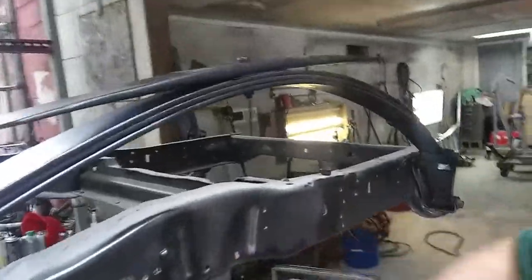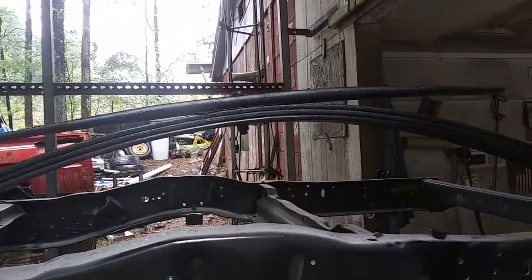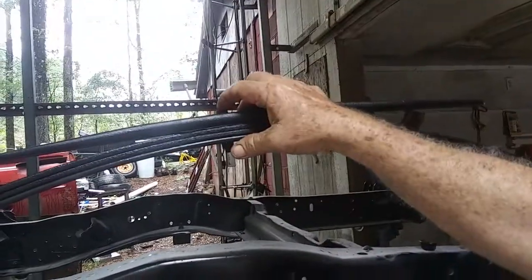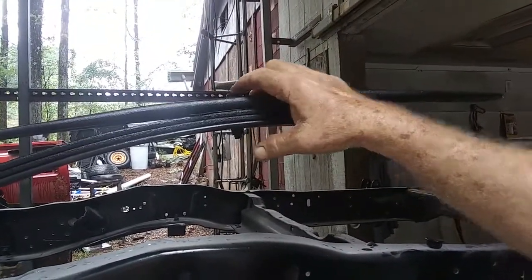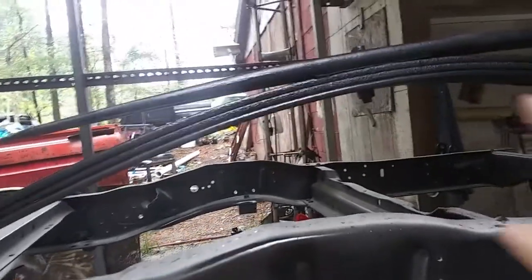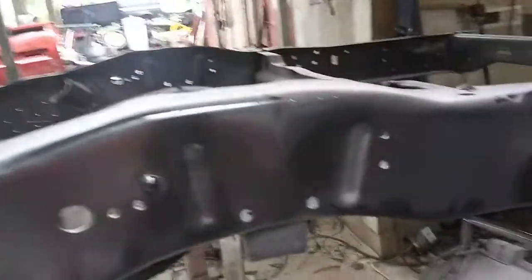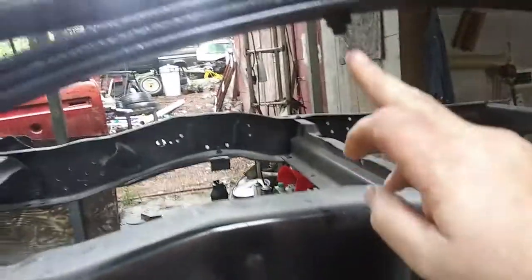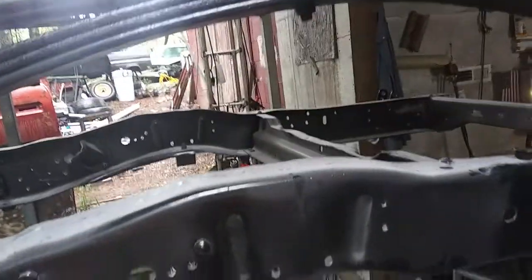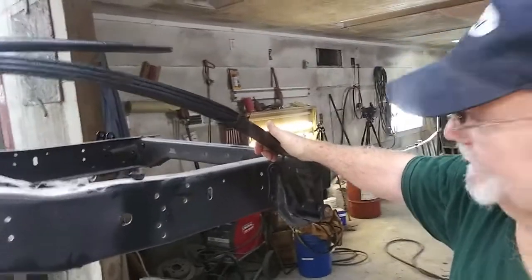We were in reverse there just a second ago, and he pulled us out of the fire. So what made you realize we had flipped the springs wrong? Well, when I seen the dowel of the center on the rear end was setting back here 6 inches off center, I knew. So this right here should fall right in somewhere in the center of that. Right there. Yeah. And guess what? What? We're still in reverse. How are we in reverse?